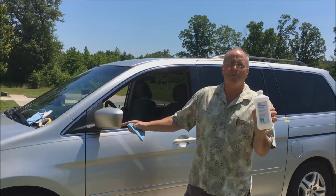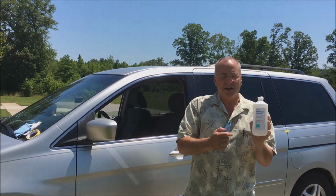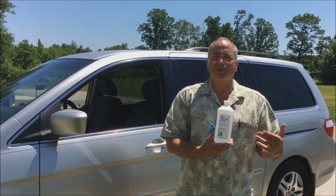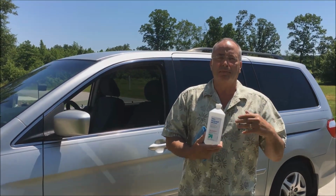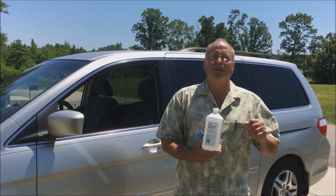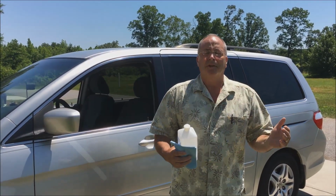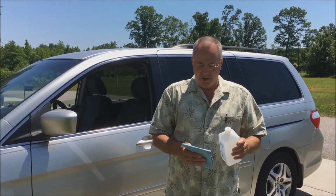I use 3M vinyl. The manufacturer wants alcohol. I use either 70%, sometimes 91%. What's nice about this 70% is it has about 30% water to rid the dirt-based contaminants, and then the alcohol cuts the greases from the air, waxes, road junk. So anyway, cleaning is most important to do correctly.